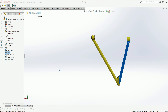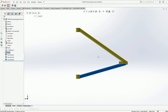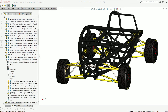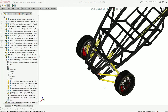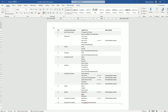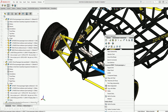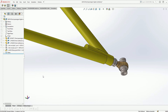A lot of design and thought went into the wishbones to get them as perfect as they are. This part needed to work together with the top wishbone for the independent suspension. I will simulate that at the end. Moving on to the front upper wishbone — opening it up to get a look inside. It's not a single part but a sub-assembly with multiple parts, including M14 rose joints.